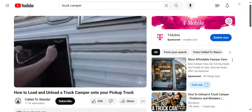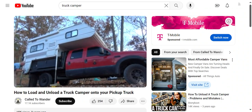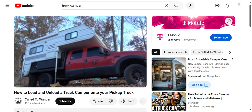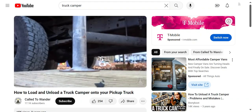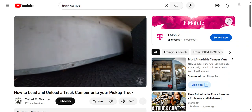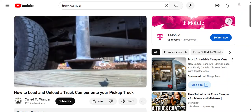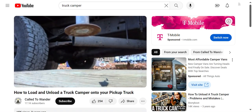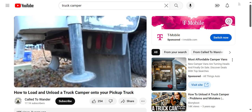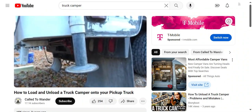When the camper is positioned perfectly over the truck and the electrical harness is in position, begin raising the jacks, which will lower the camper onto the bed of the truck. Be mindful to keep a close eye on where the camper makes contact with the truck. Ensure all jacks stay in contact with the ground until the camper is ready to sit firmly on the truck — some motors may work faster than others and some jacks may try to lift off the ground. Keep them as level as possible until the end. Then finish raising the jacks all the way up, leaving no more than six to eight inches exposed. This is particularly important on the back jacks, as they may scrape the ground going uphill if not cranked high enough.